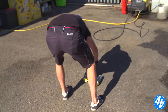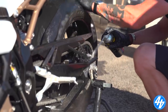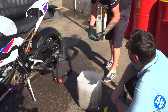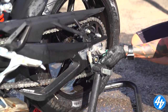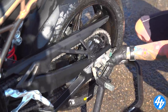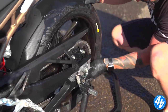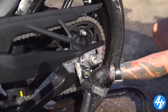With that grease on there now, you can use chain cleaner - I've got some fast acting degreaser. I'll throw these sponges away when I'm finished. It's got an old bit of Scotch-Brite. Even though it's quite a new bike, there are still bits of rust appearing on the chain already. It's not going to damage it because it's a knackered bit of Scotch-Brite. Just agitate the chain. What people forget is the chain's got a few sides to it - not just the bit you can see. The front will look beautiful and gleaming, but the back will be about three inches wide full of old rubbish and wax.